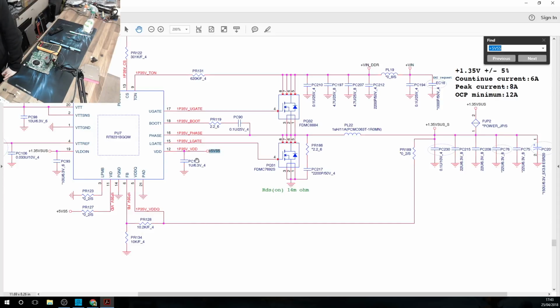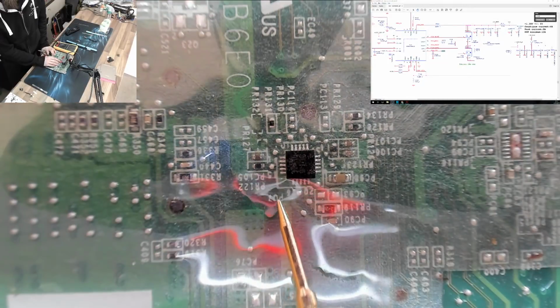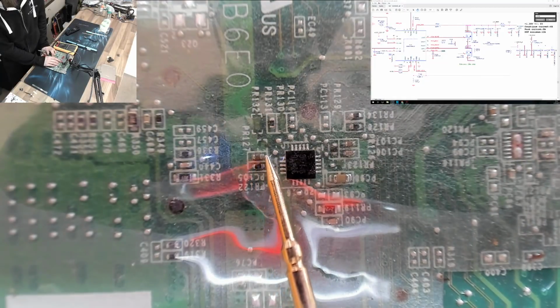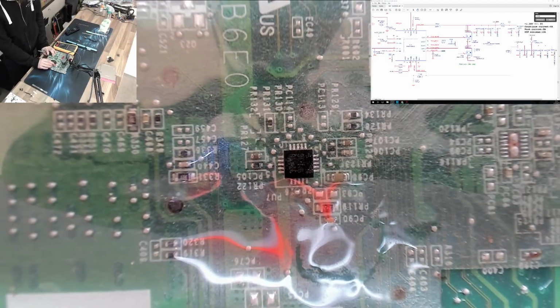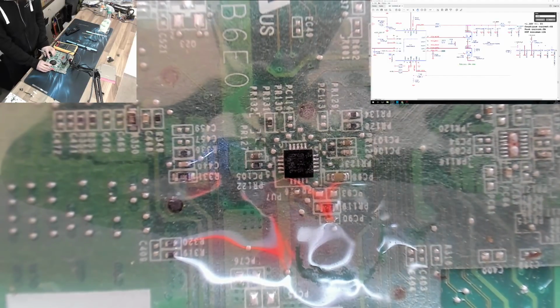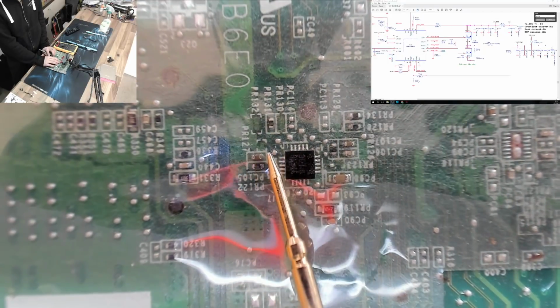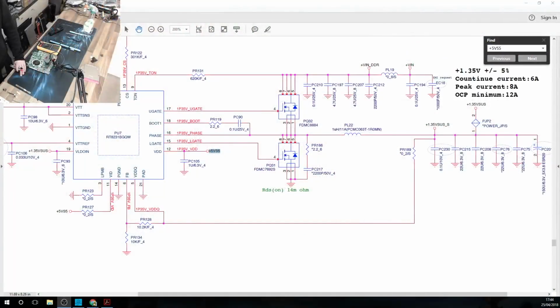Okay, we've got a capacitor to ground there, PC105. Let's just check that, PC105. That's going to be in this general area. It's going to be that guy there. That goes to ground. But we're under plastic wrap here, and this is all pristine underneath this wrap, and we're on the top of the board, which has shown no signs of liquid damage. So I've no reason to believe that there's any liquid that's gotten under here and busted that cap. So I'm not going to do anything there. I really don't think that's the answer. Let's keep searching for something that's more likely.